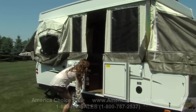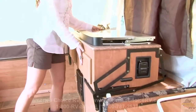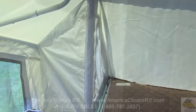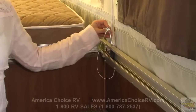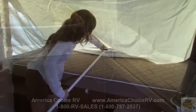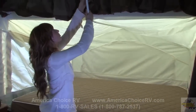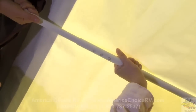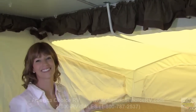It's now time to address the procedures done from inside the camper. Most Freedom models have swing-level galleys — lift the galley into place using an even swing motion. Next, zip the tent corners. The five-piece tent assembly makes it easy to repair or replace a panel should the need ever arise. Place the locking pin into the bed rail to secure the bunk. To complete the bunk setup, put the overhead support pole into the bed bow and push into place. Notice that all supports are powder coated and won't leave unsightly marks on the interior tenting. Adjust the length of the pole until the bunk material is stretched tight. Set the other bunk end pole into place and the bed ends are ready to use.